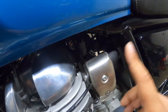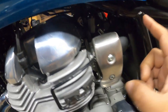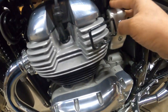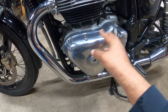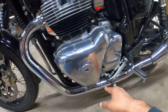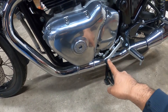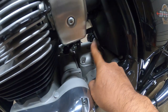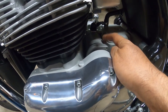Moving over to the right — I'm showing you what is accessible from this side of the bike. There's the fuel injector, this is the intake cover, this is the actual intake, and the throttle body sits underneath it. Working our way down, this first case gives you access to the actual transmission — this is a six-speed slip disc transmission. This gives you full access to the clutch if you ever need to do clutch work on this side. The clutch is manual, six-speed. This is your adjustment for your clutch lever, this is your actual clutch lever, your peg. If you need to ever replace the starter on this bike, it sits right here on the left — not the one on the right, the left.